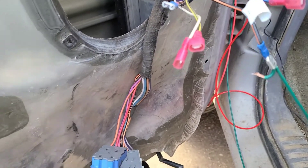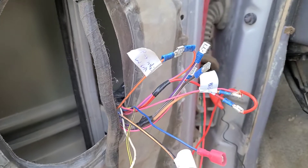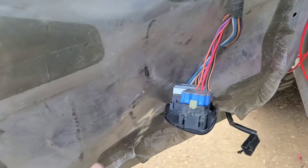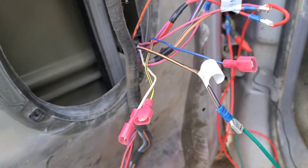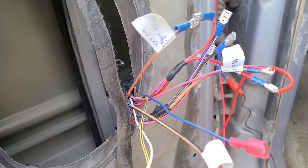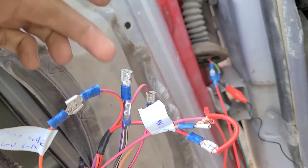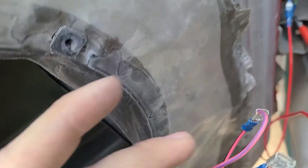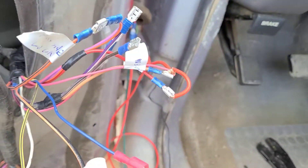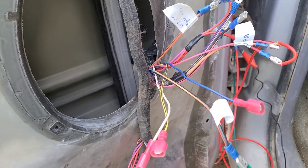I'm gonna test that quick and we'll be back to see what happens. That is conclusive — that's how it works, because now you can see that moves. That's great news; that kind of fixes up a lot of my wiring issues. I'll just redo a bunch of these connectors and connect everything together: the pink and the black goes to the pink and the purple, and the orange and the black goes to the orange and the purple. If you are starting to be as crazy as me and modifying a base model to a Laramie without any wiring harnesses...